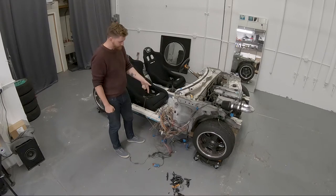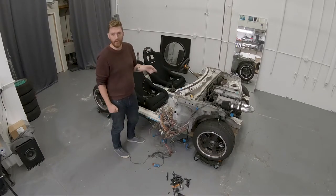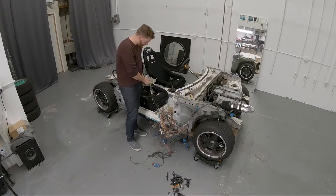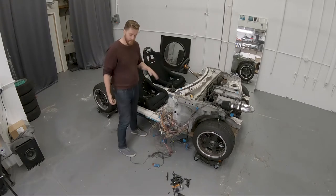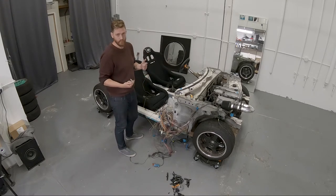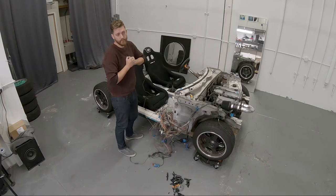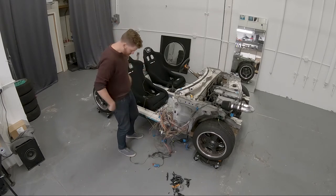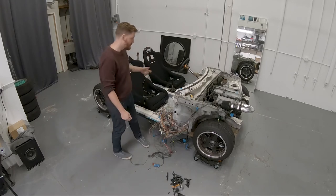So it still runs. Like I said, next weekend, gonna start taking all the unnecessary wires out. I'm gonna come back with the ECU pinout. So every wire that's coming out of here, I'll figure out exactly what it does, and I'll essentially cut them from the base here, so that way I can de-loom them from that side as well. Still a lot of work to do just on the wiring, but pretty soon, once that's all cleaned up and done, then all that's left is to clean up all these cuts with the angle grinder and then start building the cage. We should have a pipe bender pretty soon. And then once I get the pipe bender, order some pipes, test it out, and then start doing it. So yeah, until next week.